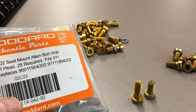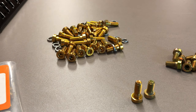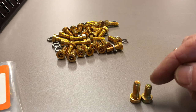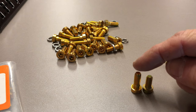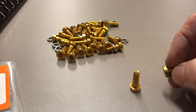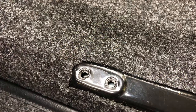Looking at the fasteners, I'm replacing most of the hardware mounting the seat rails and extensions. Here's a part number I got from Stoddard — they're calling out 28 screws and washers to do the whole set. However, in my car I had two different length bolts. I think the reason for a shorter bolt on some of these is that on one of the rails there's a fuel line running right underneath, so if you run a longer screw in there you could actually run into your fuel line. You want to make sure the fuel line that runs underneath those bolt holes is either pushed far enough away to clear, or you'll have to go with a shorter screw. I couldn't find the shorter one from Stoddard so I refinished my originals for that rail.